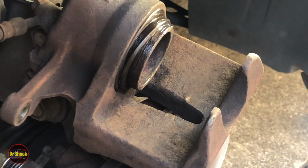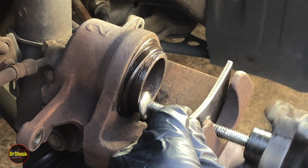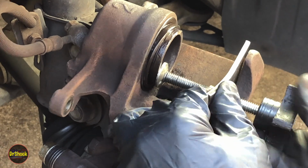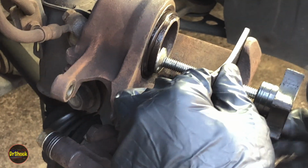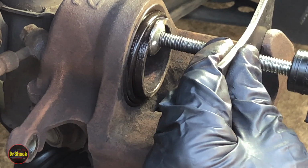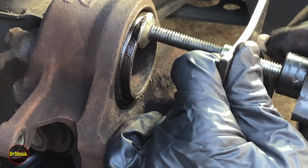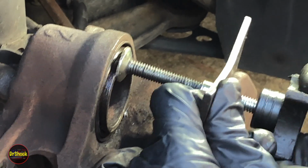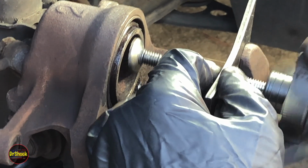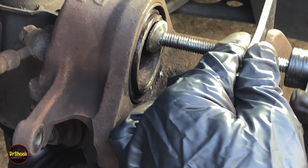All right. Put the tube back on our lubricant. Grab our compressor. See if we can get it without throwing the old shoe in there. I'm assuming the old pad. Yeah, I think that'll work fine. Normally I just grab the old pad, put it in here, and compress it like that, but you can do it this way too. Before you do something like this, make sure that you haven't put too much fluid in the reservoir, or this step will cause it to come out and you'll get a nasty surprise.